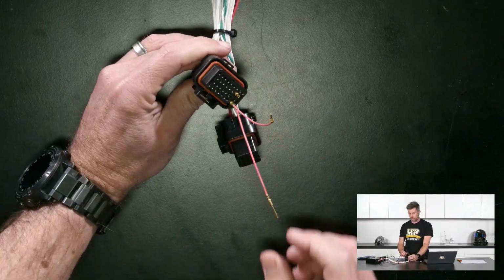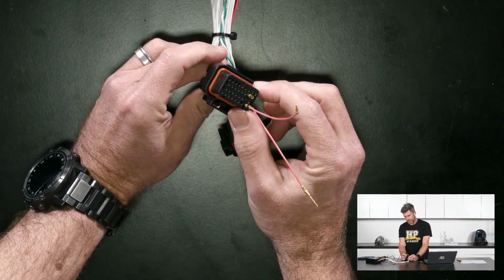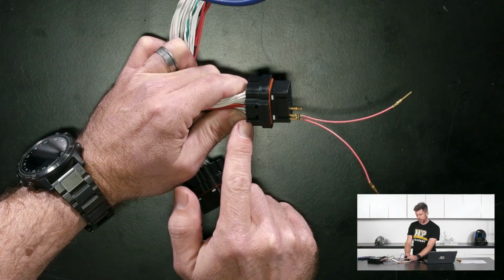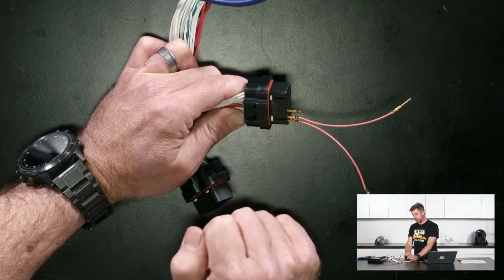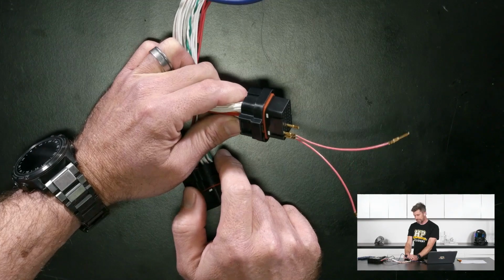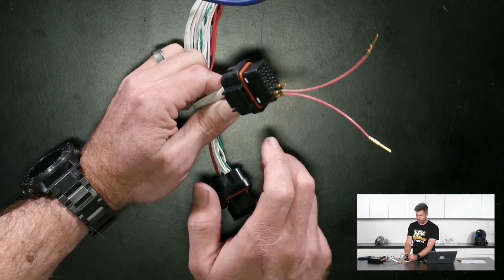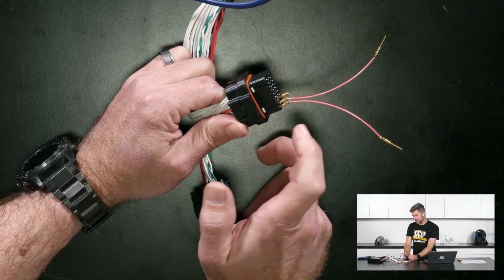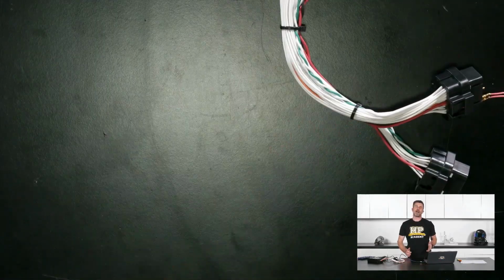Okay, so not very practical or realistic, because obviously I'm not going to be plugging this back into the ECU. But as I've said, if you extract those 3 conductors out of the back of the AMP Superseal connector, you can then jumper them in the way I've just described and get access to everything. One thing to be mindful of, of course, is that we need to make sure nothing here is going to short out against another wire. With our engine speed and position sensors, it's not so much a risk of damaging anything, but that in and of itself is going to introduce problems with the running of the vehicle, which is exactly what we're probably trying to diagnose.